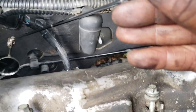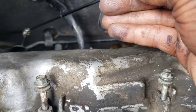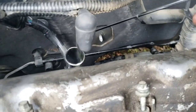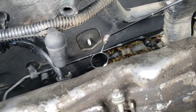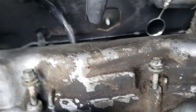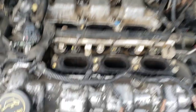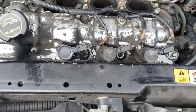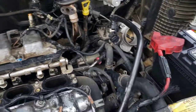Now, if you don't have a mirror you should — especially on something like this — so you can go around the back and look and make sure the gasket didn't fall out, make sure you didn't lose a bolt. Because you're on the back side and you really can't see. Have your mirror. And just like that, got our valve covers back on, coil packs reinstalled.